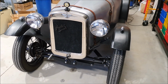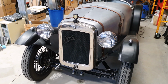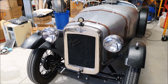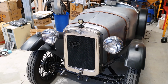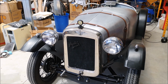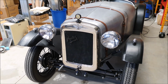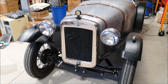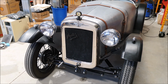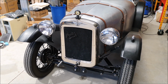So I've been doing some research, and for the vintage cars, the pre-war cars, which aren't running a pressurized cooling system, there are better things you can use. So I'm getting hold of some Fernox F1, which is an additive that gets added to central heating systems to stop corrosion. Central heating isn't quite so common in New Zealand, so it's not as easy to get here, and it's quite expensive. The one I'm looking at is the Fernox F1, which sells in the UK for about £12 for 500 ml. The price I've been quoted here is 70 to 80 New Zealand dollars,